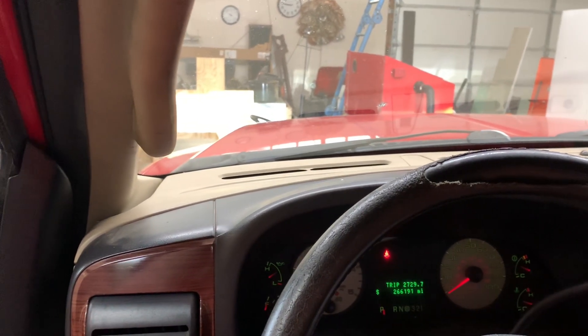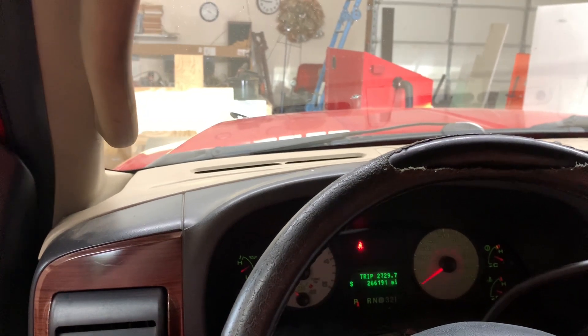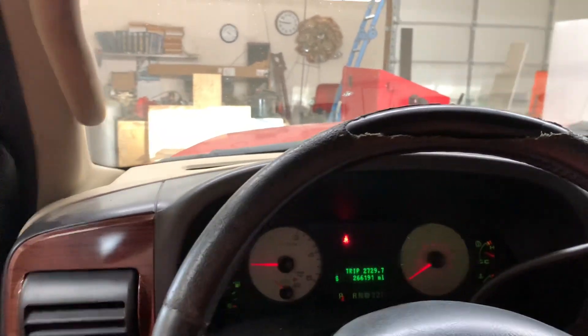My grandpa did say I might have to drive it a little bit, come back and recharge the system or add some more Freon. But I really think that old condenser was part of our problem — I would almost be willing to bet it was plugged with something. I almost figure it probably had some stop leak in it from the previous owner, because it was super heavy. But we've got the new one in, it seems to be working fine, no leaks that we know about so far. I might have to drive it a little bit, let it circulate, pull it back in, put the gauges on it and test it, see if it needs any more.